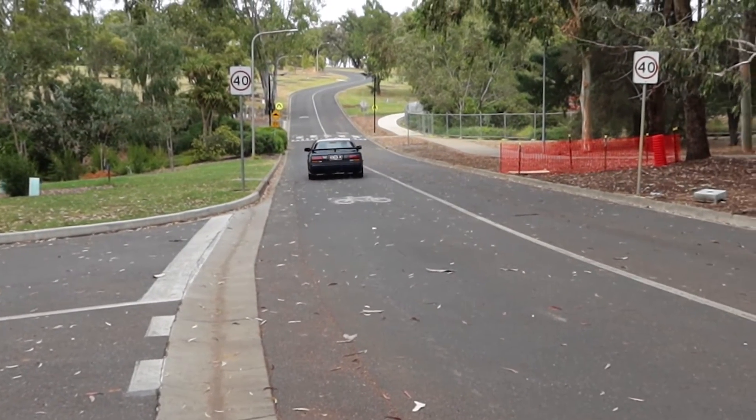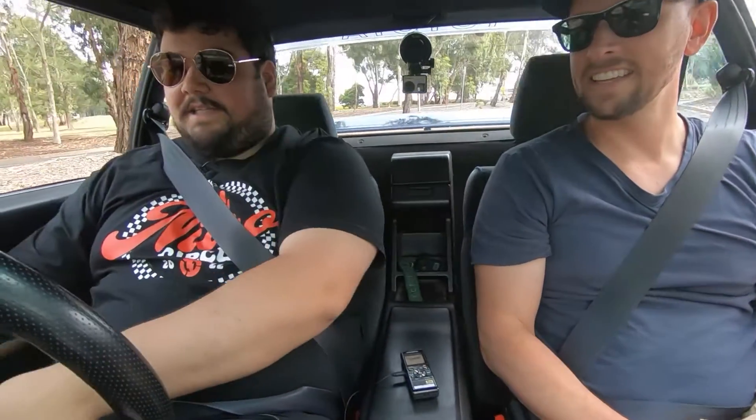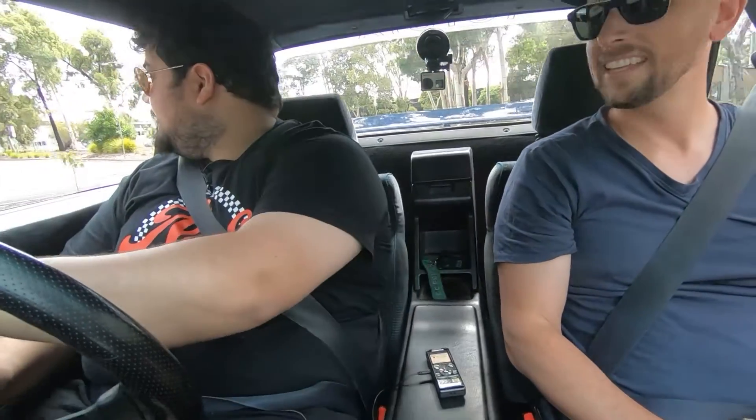Being that it's got no clutch, you just don't press the clutch and put it in second gear. It'll take off in any gear really, but you just use second gear for under 60 km/h. You can come to a complete stop in second gear, no worries. It works like an automatic sort of thing — quite simple. You just use the gears for a bit more range on what you want the motor to do.